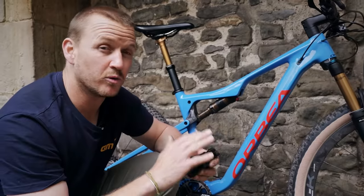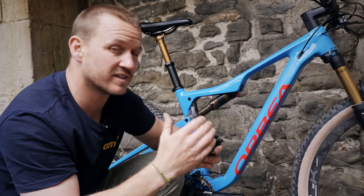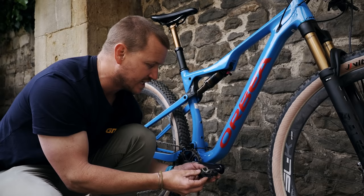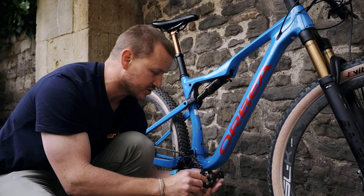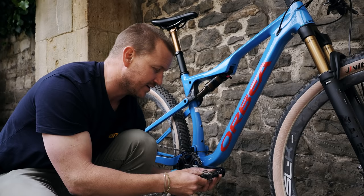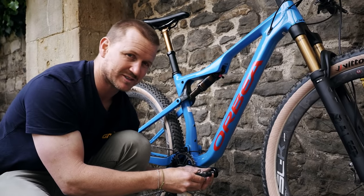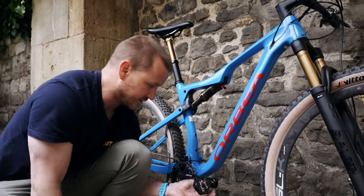Before you install a new pedal or even an older pedal, it's good practice to add a little bit of grease to the threads or some anti-seize compound, so it doesn't seize up in your crank arms if it's going to be in there for a long time. Now that you've found the correct pedal for the right hand side, get it as level as possible in the crank arm, get it into the threads, and spin it gently until it bites — you'll feel it just go straight in. If for some reason the pedal is getting too tight on the threads, stop, because you do not want to damage your crank arms. That has gone in there very smoothly.